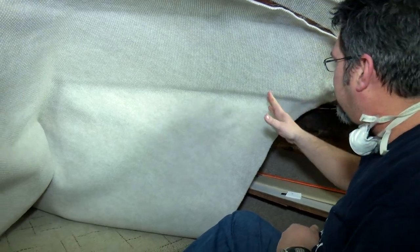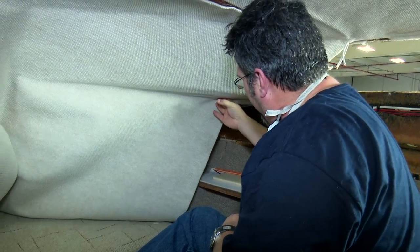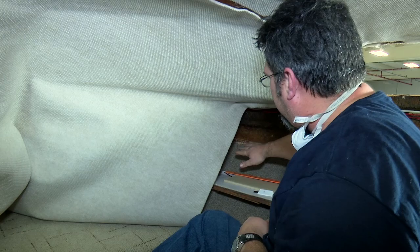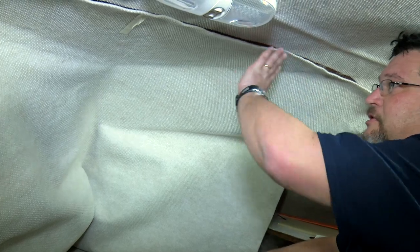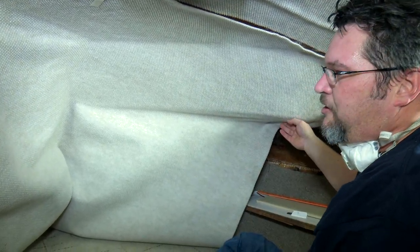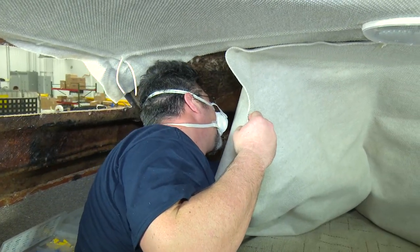Now, obviously, we're not going to make it all the way to the side of the hull, and that's okay. On the underside here, there's a groove. So my goal here is to get it into that groove, because then I'll take the side portion and bring it up and match them up in the groove. This headliner, you can match up fairly well on a nice smooth surface. It's even a little bit easier yet to match up two pieces in a groove where you can kind of overcut them a little bit and tuck everything in. You probably won't be able to see any of this, but...